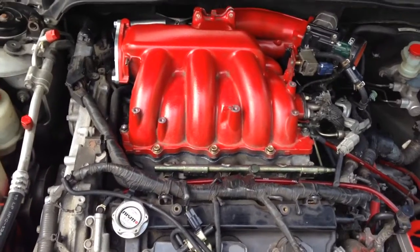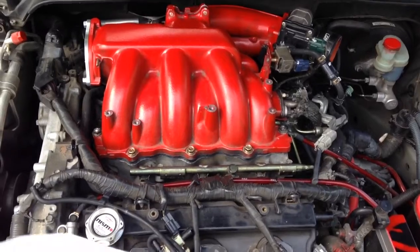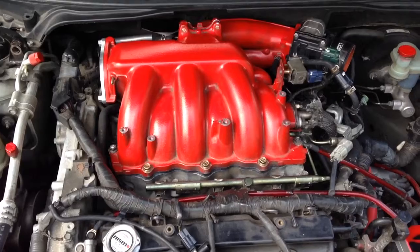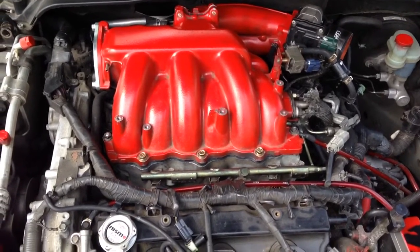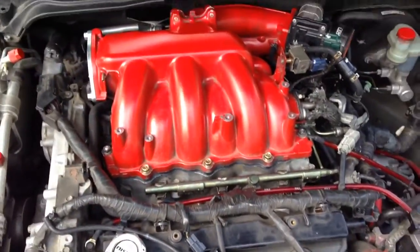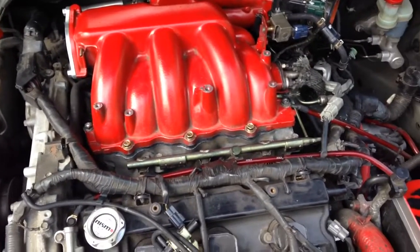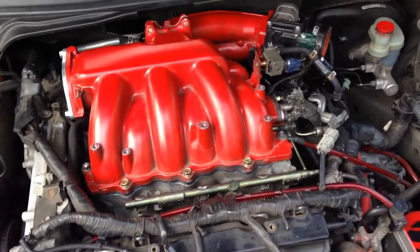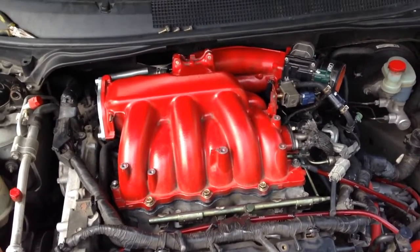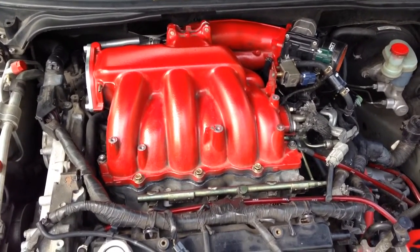Again, once you have everything put in and everything is tightened, good to go, you have to let it settle for at least an hour. At least an hour. Still got to put these hoses on in the back, but I'm gonna get to that in a second when I hook all this other stuff back up. So just remember, give it that hour to sit, at least, bare minimum. You can't just install this and then pull off, because that's where some of the intake leaks come. So let me finish this up. I'll give y'all that finished product, baby.